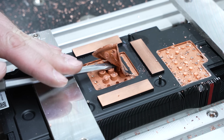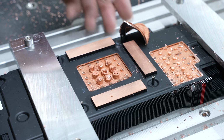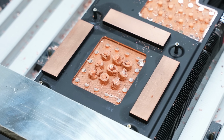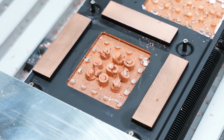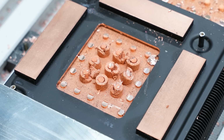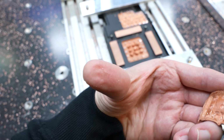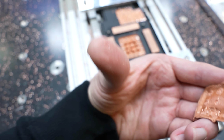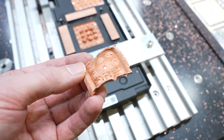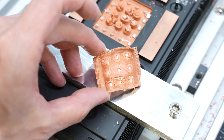You can see again those struts for additional support, but these seem to be surrounded by additional material, and some of it just breaks apart while removing the surface. The way it looks very brittle, you already know this has to be some kind of copper sinter material. While removing the GPU cooling part, this cold plate area, I also noticed that the mesh seemed to still be wet. You can see some moisture left on my thumb, and I couldn't smell anything. Just from the viscosity and everything, this could very well be normal water.